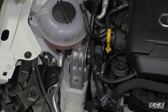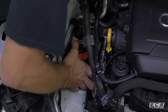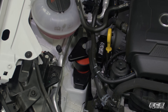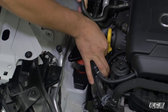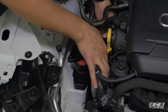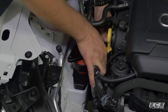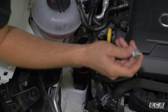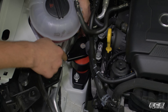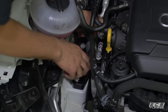Now we should be able to get the mount out — and that's it. Here we've got our ECS Tuning mount ready to go in. The bolts you took out are no longer good — they are torque-to-yield stretch bolts, so they always need to be replaced. Our mount comes with replacement hardware. We'll start by installing the two 18mm bolts hand-tight, then the two 16mm bolts into the base plate on the body side. The bolt with the stud on top of the hex goes towards the front. You may also notice a bracket — that's for California cars with a charcoal canister, and we'll be using it for a catch can installation later.